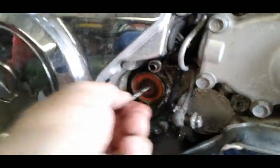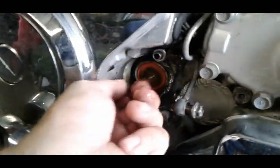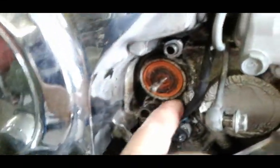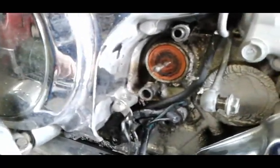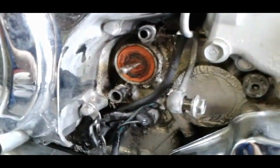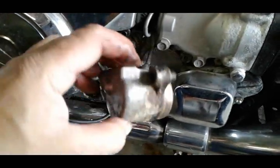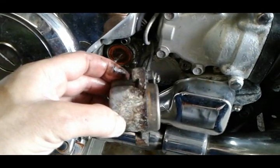This is the push rod I was telling you about — it goes right through the engine. It's usually a two-piece deal, and you have an oil seal here. It's also a good time to inspect the oil seal. We don't see any oil — all we see is the peeling paint, so that's our brake fluid leak — but no oil, so we are good there. It's up to you if you want to replace your oil seal while you're here, but if it's not leaking, leave it alone. The slave cylinder looks pretty nasty on the outside, but inside it should be in good shape — we're just going to need the new rubber seal.